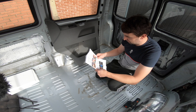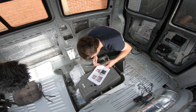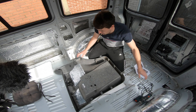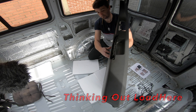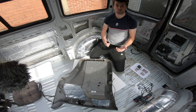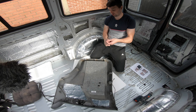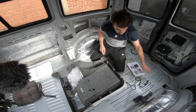Now we're on to the drilling of the door card, so let me educate myself first. I've got a pencil and a little ruler. So there's the flange — 10 millimeters away. If I drill that through, it'll bring it right into this corner here. The key with this is it looks like you want the light to be discreet, so you don't want the LEDs on show. The goal is to tuck them up behind the lip or in the corner so you can't see the light — you just get the illumination. That's a nice touch. We'll drill this one through first.